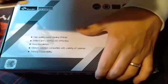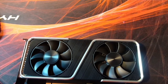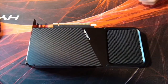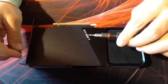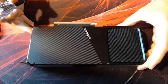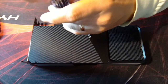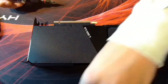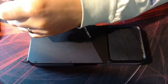Easy video today, so let's get started. My screws — I believe there are some T8s, and then I believe there's going to be some T6s. If you've done a teardown on a 3070 Founders Edition, this shouldn't be too strange. I'm just going to go ahead and start with these T8s. I'm not going to keep track of where the screws were — from what I've seen, it's fairly simple.